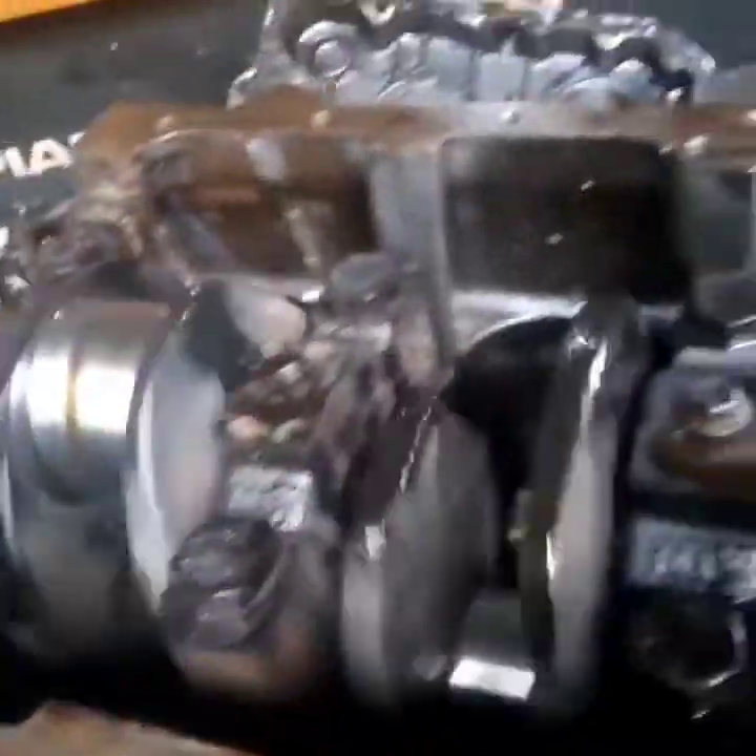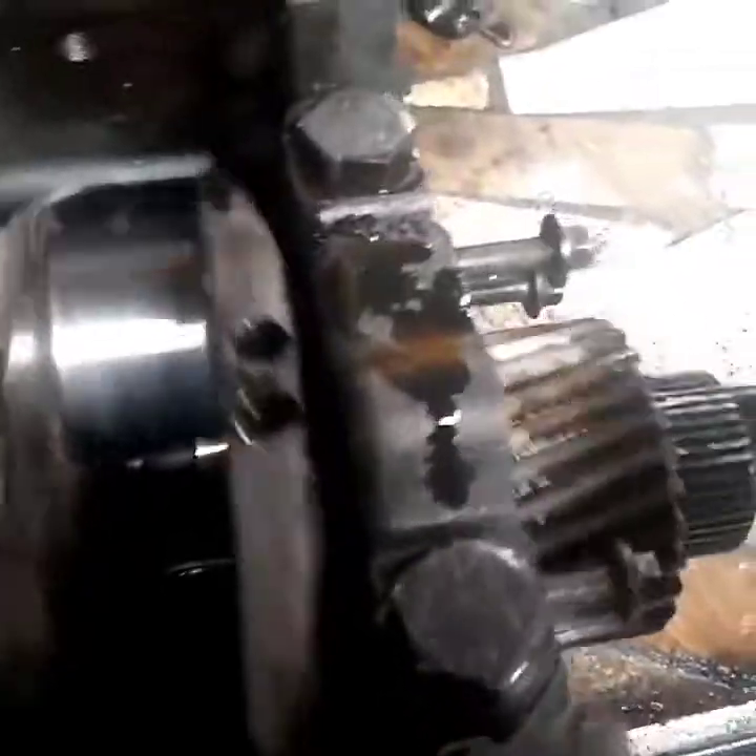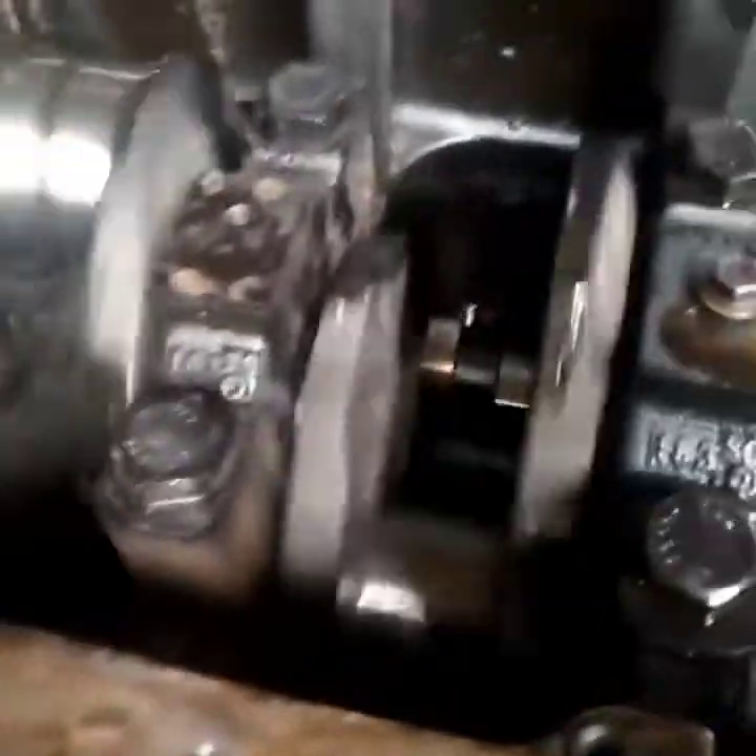To be sure that your crankshaft installation is fine, you can see I'm turning the crankshaft. Before you turn the crankshaft, make sure you have put your main bearing caps on and torqued them — then you can turn your crankshaft. Turn it very well to confirm that your crankshaft is properly installed. Don't forget to subscribe to my channel — this is my job and as I'm doing it I'll be taking you along, so subscribe.